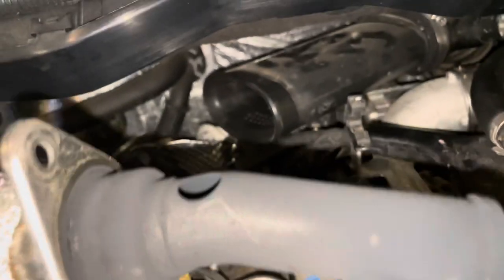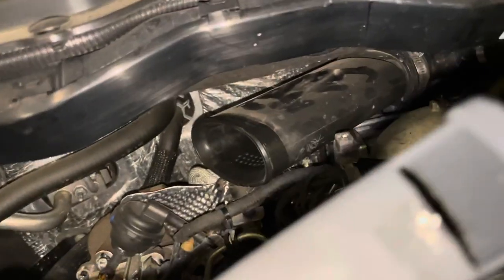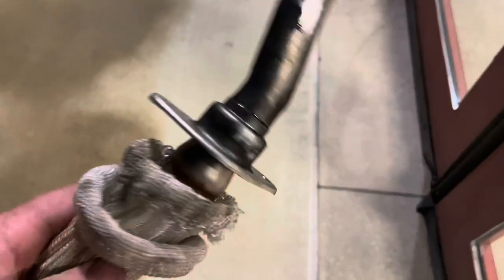Well, that's really not terrible. I expected it to be worse, but I'm still going to clean it up anyway. It's still not as clean as I'd like it, so I'm going to take a brush and get after it. A lot better than it was — much better, a lot less soot. Slide it back in, bolt it back up, and that should clear our electronic throttle control problem.